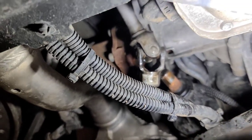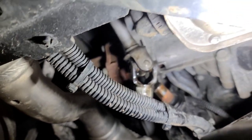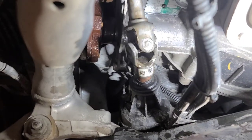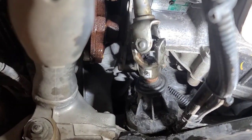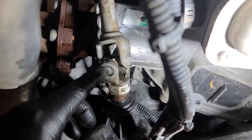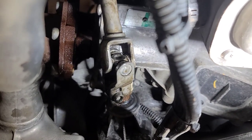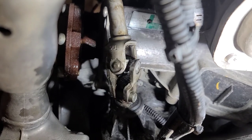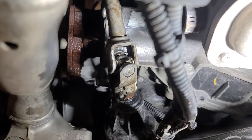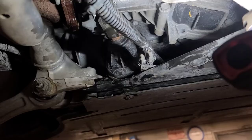The proper fix is to replace the intermediate steering shaft, but I'm going to see if I can drill into the little cap on either side and inject some penetrating fluid. I managed to get it freed up — I had to pick the seals out of there and then got some penetrating fluid into the rollers. Now that there are no seals in there it's probably going to rust up significantly faster. I'm going to put some gear oil on those crosses, but it really needs an intermediate steering shaft.